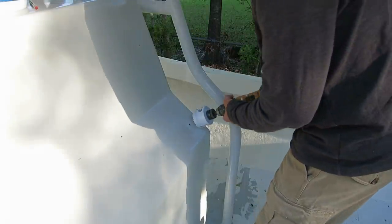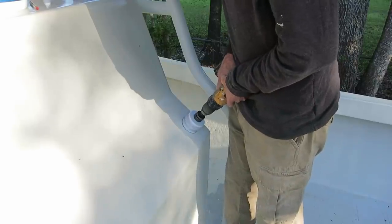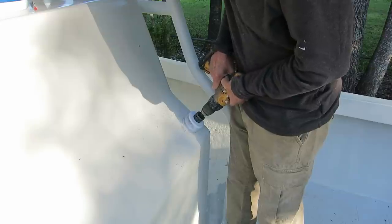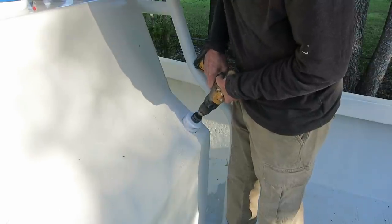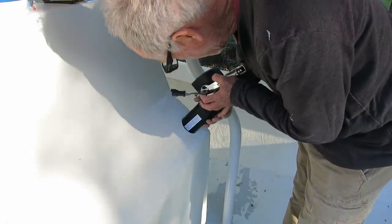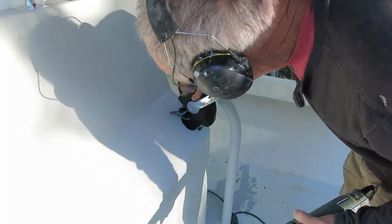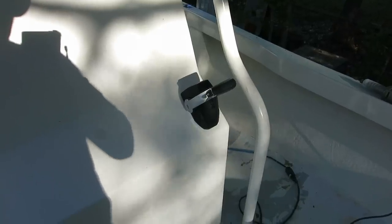I'm drilling a hole for the new used shifter. I got it as far to the right as I dare, and the hole is not centered on the shifter — the part that goes through the dash is kind of toward the bottom, so it's an educated guess. I got it where I think it needs to be. It was a little too snug, so I got the pencil grinder out and made the holes just a little bigger until it could slide down and the mounting bolts touch the console. Drilled them out and it's done.